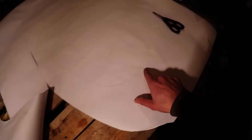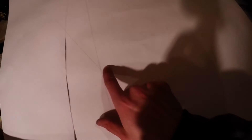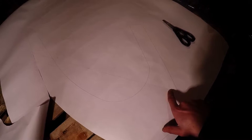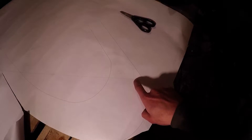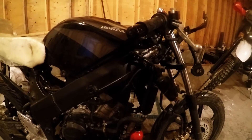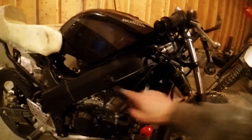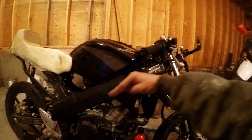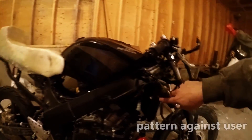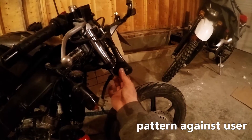One more thing to explain: this slightly less dark line is my scale line and my base point line. Essentially these are two base points I picked on the bike — what they line up to are this point and the dead center of this hole. So I measured that, that's why I set my scale. When I cut my form, I'm going to transfer that line. I can create that same line, keep this bottom line level, make an imaginary intersection here, go up, catch this — which is what I'll be bolting to — and I'll put my frame slider there.